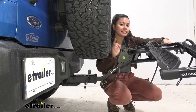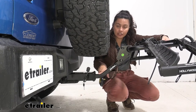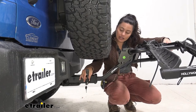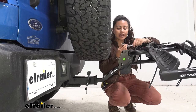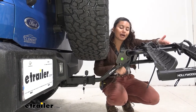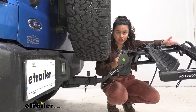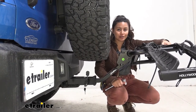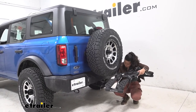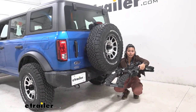Now let's talk about how this fits into our hitch, which is also important for installing and uninstalling your bike rack. We have an inch and a quarter shank with an included two-inch hitch adapter. That pops right into your hitch receiver and tightens down with an anti-rattle bolt and a lock. The anti-rattle bolt uses a three-quarter-inch socket or wrench to tighten down. If you don't have one, you can buy one right here at E-Trailer. If you want to take this off quickly, you just undo that bolt and you can toss this into your trunk. To demonstrate how the anti-rattle works: even as I shake the bike rack by the shank to create that ratchet movement and vibration, notice how I'm moving our Bronco — that's because the connection is nice and secure, even with that adapter.